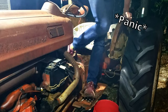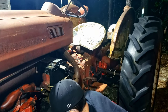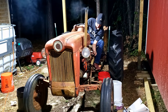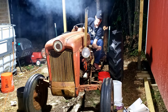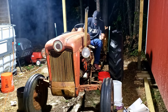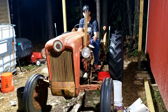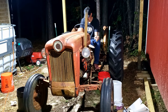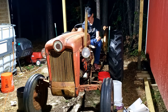I completely forgot to put the filter back on the tractor, and oil was dribbling out after I turned it on. Thank goodness I didn't have it running for long. Van had warned me about that. What made it even scarier was that even after I put the old oil back in — don't worry, it was a clean bucket — it would not turn over. I later found out the starter can turn over, but it's not powerful enough to turn the tractor fast enough to get it to start. I need to boost it to a high enough voltage. I might cannibalize the other starter or fix the brushes or coil, but for now I'm okay with jump-starting it.